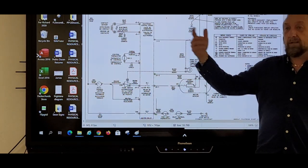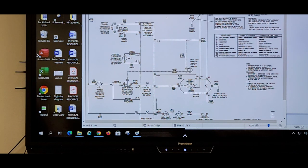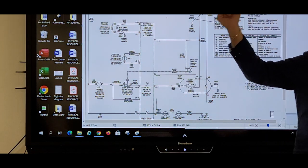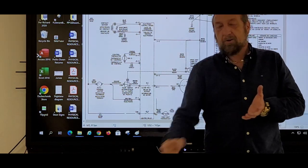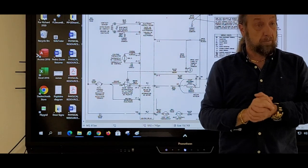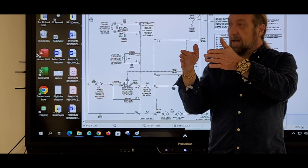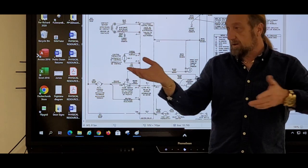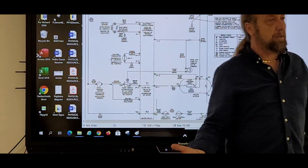So when you guys are doing these projects with the machines, you're taking stuff off and you're ohming them out. But what I want you guys to do, and I haven't really pressed you, and Richie, you haven't even gotten to that point yet, you're still putting the machine together. But now I want you to go into diagnostics and energize the pump. Well, if you hear the pump running, that's good. But what about the heating element in the drum of the washer? The thermistor, I guess? I think that's a thermistor. Well, it has a thermistor and a heater together, in the drum of the washing machine. Most of you guys tested it by now. How do I know if that heater's working? I can't open a drum up and feel the heat.